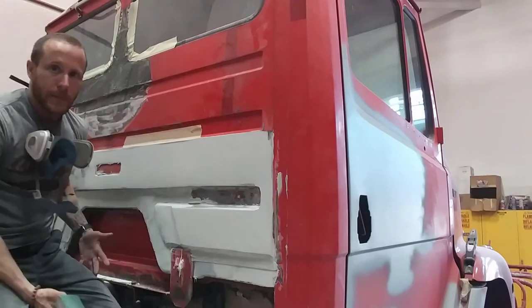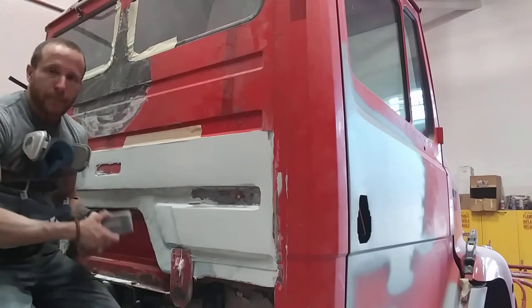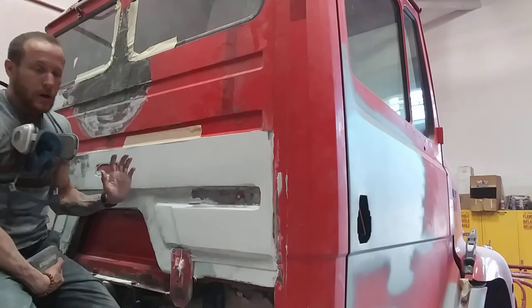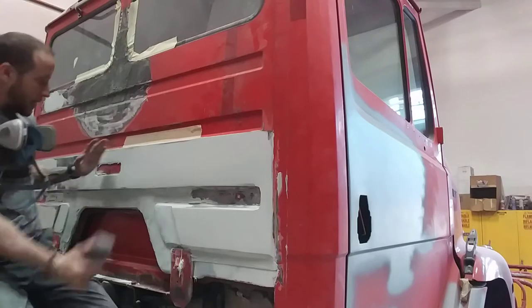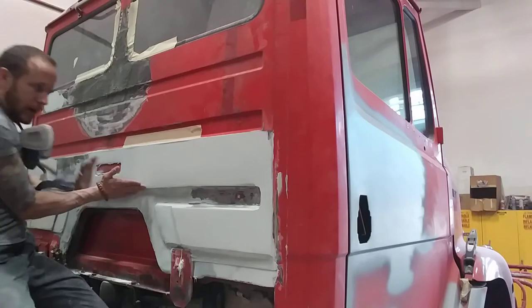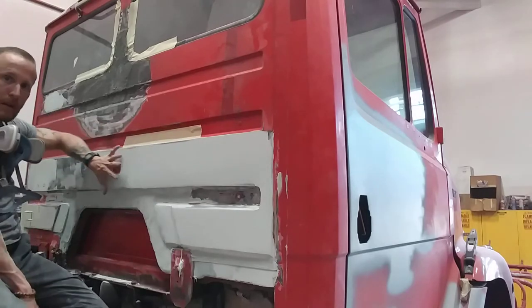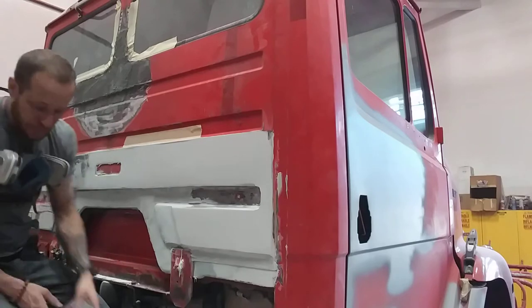You're painting this entire panel. If you're doing a car, you're going to try to blend to the adjacent panels anyway. If you have to stretch that bodywork to make it straight, that's what you've got to do. There's no keeping it small. If you try to keep it small, you're going to have a big bump right there. You want to stretch it out, even it, and make an optical illusion out of this body line here — it's protruding outward. As long as you keep it long and big and stretch it out, you'll be fine.